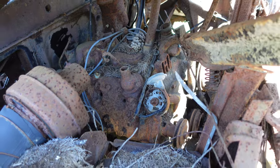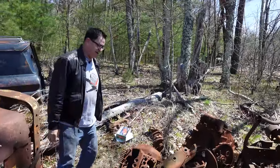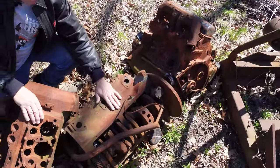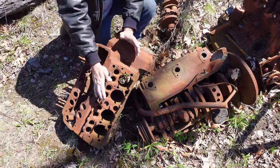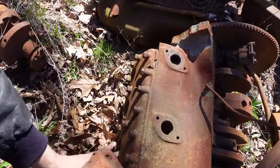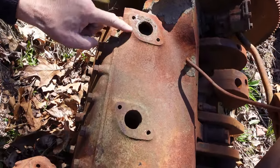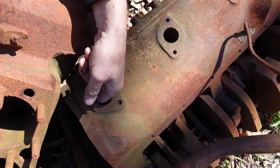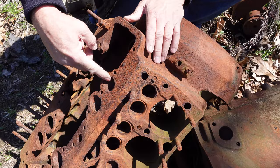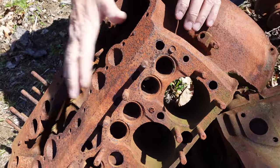So what is a flathead? Follow me, let's explore. You can see right here why they call it the flathead - this is the cylinder head and it is indeed flat. The exhaust ports are actually in the block right here. There's three of them, and they make their way from the cylinders out to a manifold. If you think these are pretty restricted and convoluted, you're right. The intake ports aren't much better. These are the intake ports right here that go from the intake valve to the manifold being fed by the carburetor.